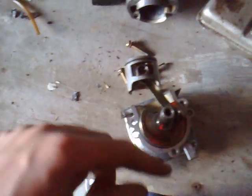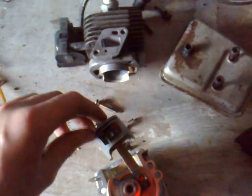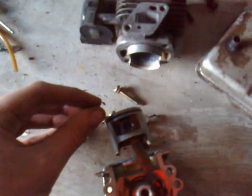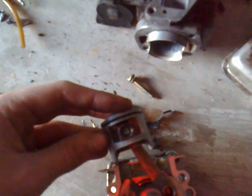With four-strokes, like I said, they have a bath of oil and these little flicker things, so the oil flicks up to the side of the piston to lubricate it. With a two-stroke, you only have one ring — just a compression ring. With four-strokes, you have three rings: two compression rings and one oil ring. Your two compression rings are at the top for compression, and your oil ring is at the bottom. The oil is a bit thicker, so it can go on the side and lubricate the piston, but it can't go past those two top rings.